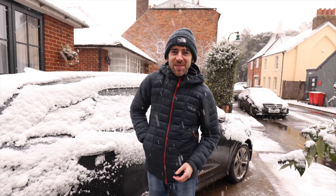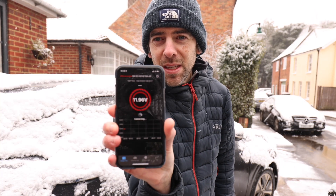We don't normally get snow down here in Canterbury, so this is a bit of a novelty. I'm pretty definite that the car's not going to open today — I think the 12-volt is flat. I've got a battery monitor plugged in that tells me the charge of the 12-volt at all times, and last night it didn't look like it got charged up at all. It now reads low power: 11.9 volts, which is actually zero percent charge on the 12-volt battery.